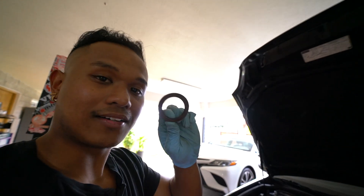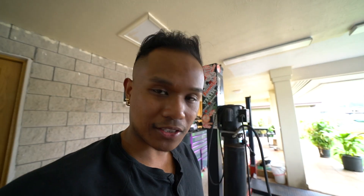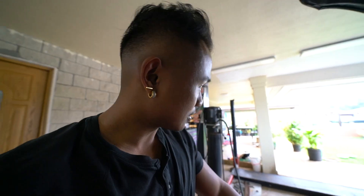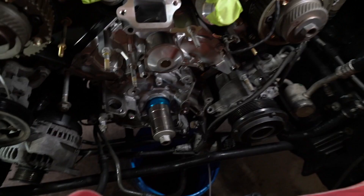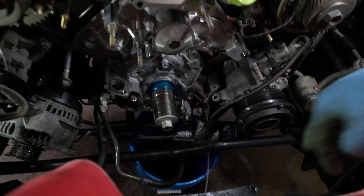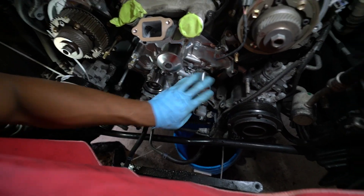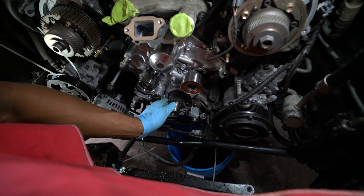Got the old crank seal out — I just used the OTC crank puller from that set. You use it like a puller. Try not to scratch the crank — last thing you want is big gouges in it because then it'll leak oil and won't seal. We're going to install the new seal using the crank bolt and OTC tool adapters to push the seal in flush. Then install the new idler pulleys, crank gear back on, and we're going to put the belt back on.